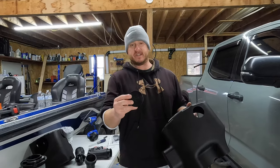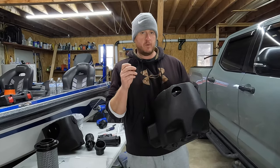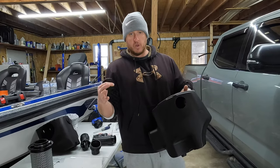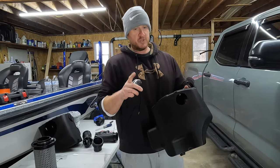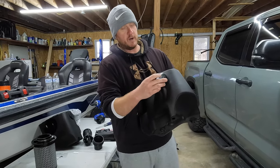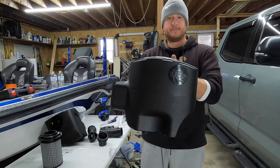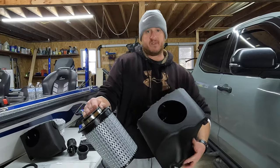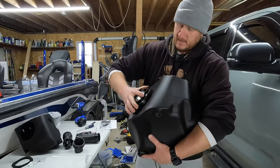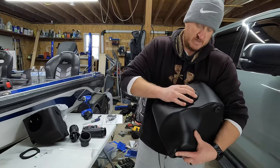Next step in prepping the housing: take one of the rubber caps and pop it into the front of the air box. What this does is when you get it installed in the truck, it stops warm air from getting into the intake box — warm air is not a friend and you're going to lose a little performance. I am going to do something a little different with that in the future, so make sure you subscribe and turn on the bell. For now, simply pop the plug in. Next, take one of the filters and install it before putting the housing in the truck just to make it easier — just drop it in and push it down, making sure it's sealed into the housing.